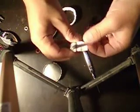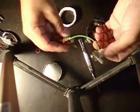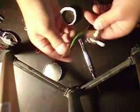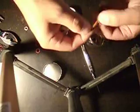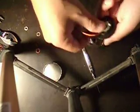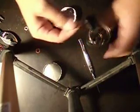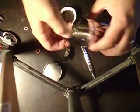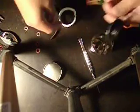You'll end up with this sort of ground hummy type noise that is not what you want to get out of your mic. You don't really need to worry about any other place, unless you have some exposed wiring. If you soldered two wires together, if you had leads coming out of your mic, you're going to want to insulate those with some electrical tape, because anywhere a bare wire can make contact with the metal shell, that's a potential ground loop and you're going to get hum.